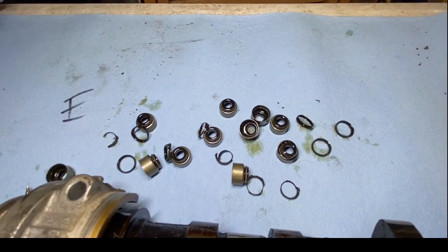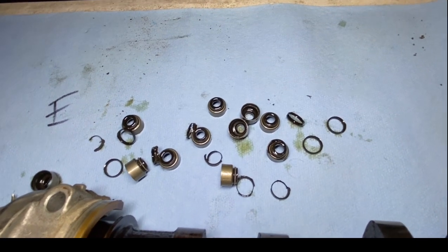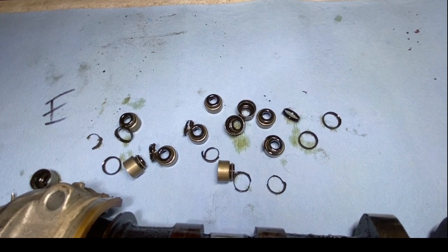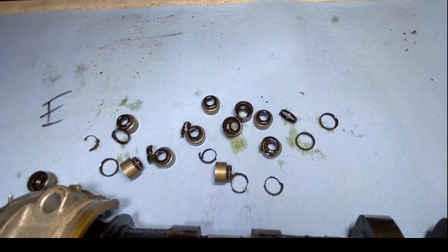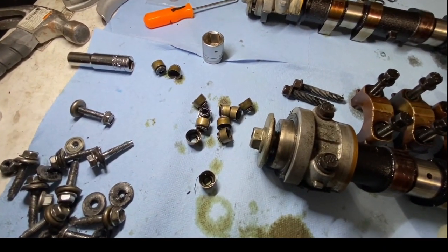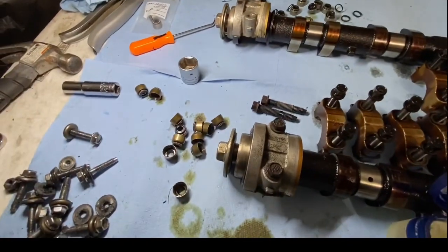As to the exhaust side, yeah, they were all bad. You'll see in the video itself, if you forward all the way towards the end, I literally checked every single valve to make sure that there's nothing or excessive rubber pieces left over. So the exhaust ones were pretty much every single one done. I had to completely pull them out. I checked the intake side, and I don't think anything was stuck on the intake side, but I double checked everything. So valve stems are done.